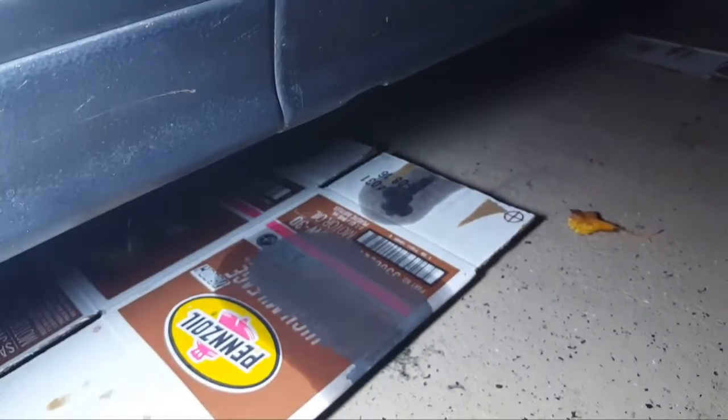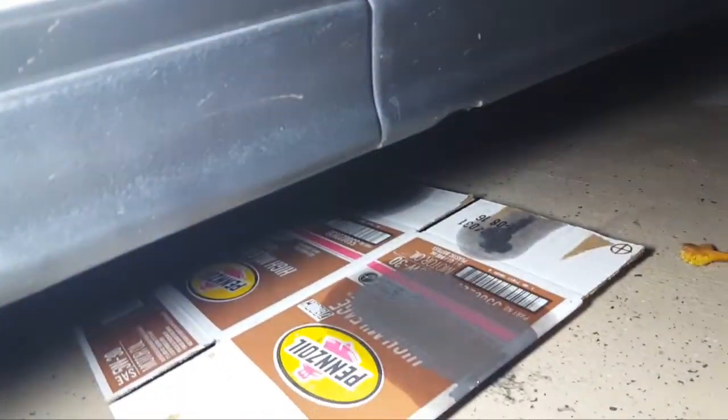What a job! I'm so glad I don't have to do this again. I've got to grease up the rear though — that's going to be a bit tricky, but just lots and lots of grease. Let me show you where all that grease is going to run down. Right here behind the front wheels, see there's a nice little puddle of grease? The other side is considerably worse because I hit it hard over the last five to six days of spraying. That's why it drains out of those drainage tubes from the top. Keep those holes clear — you don't want them to clog up, otherwise water will get in through your headliner.